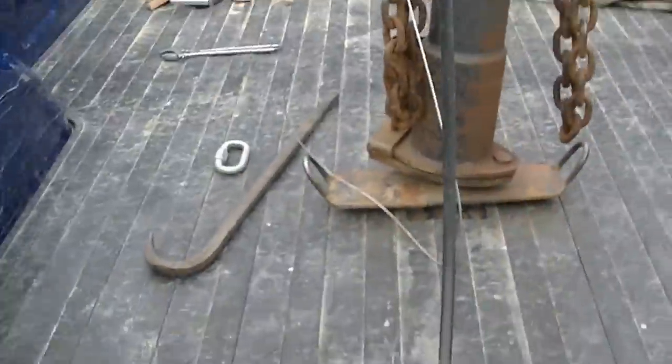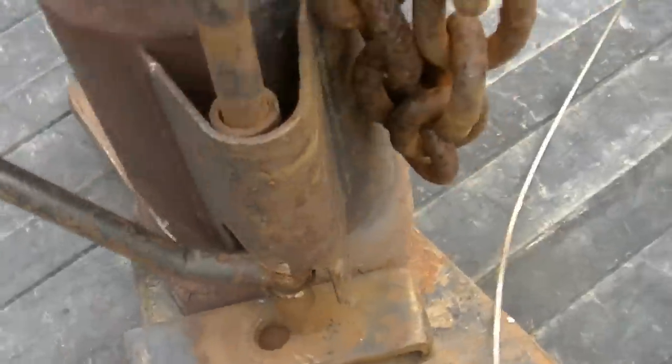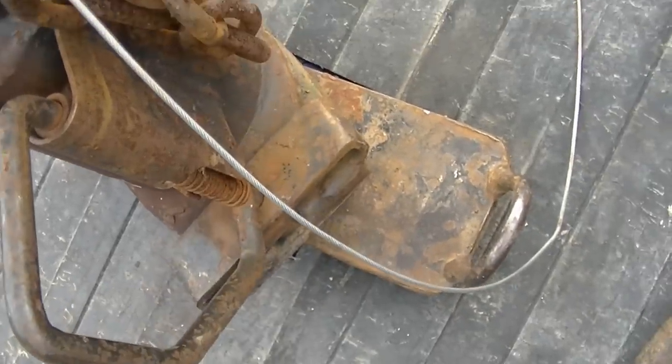Next thing I'm going to do — hop up in. You always want to make sure that you lock the trailer itself to the fifth wheel. Here I'm going to kick it into place and turn this handle to lock it. There she's locked. So now in theory the trailer should not roll away.